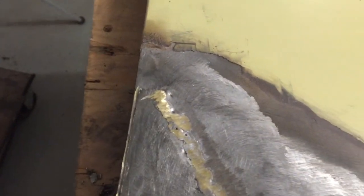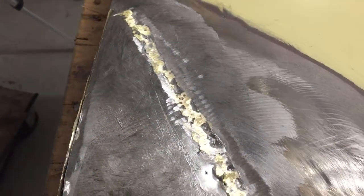The other problem with brazing rod is the next guy. When this patch panel was done, it was done with the idea of just get it done fast and easy — fill over it with lead or filler and be done with it. The problem is when you have a car like this that has a longevity that could go 100 years, as long as it's not wrecked, and somebody else down the line like me now is having to repair this — not only is that not a good solid weld, but now the metal is contaminated with brass. So along here where it's been brazed, I'm going to have to make sure to get rid of all the remnants of brass in that metal. I may have to make a whole new lip here to get rid of that brass, otherwise my weld is just not going to bond — it's going to crack and blister and bubble and be full of holes. I didn't do this weld, but I did something like it. And now I'm the next guy.